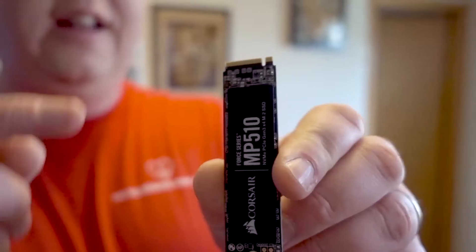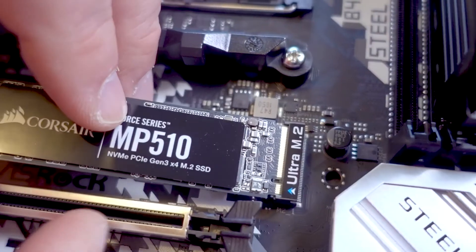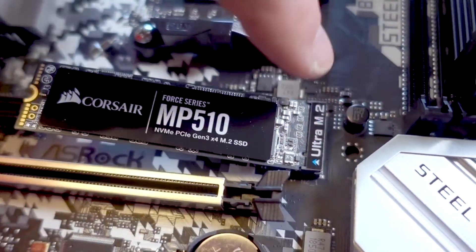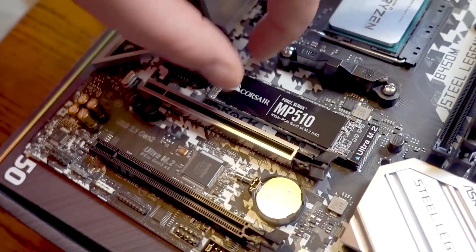Now for the M.2 — on this board we're going to use the Ultra M.2, which is M.2-1, the first slot. Don't use that second one. The M.2 drive has a little key notch on it. If you look at the slot, you can see the corresponding key. You'll just angle it in, match the slot, and give it a firm push until you don't see any copper exposed. Then take the M.2 screw and screw it in — doesn't need to be tight, just snug. That's as easy as it is. We're almost ready to install this. We're going to flip over to the case, and this will be the time-lapse part.